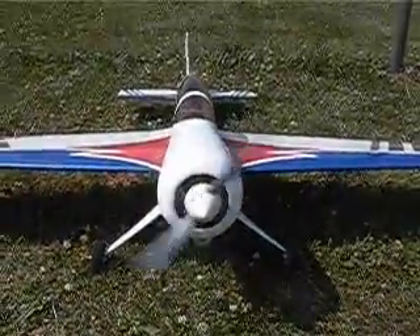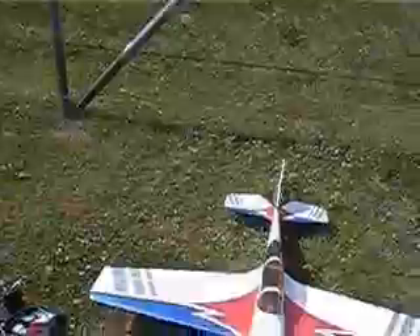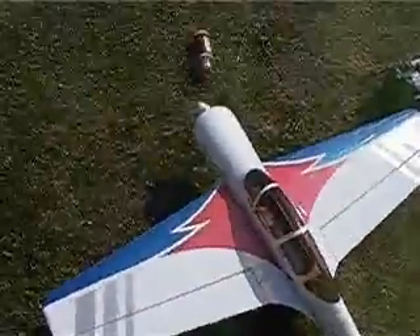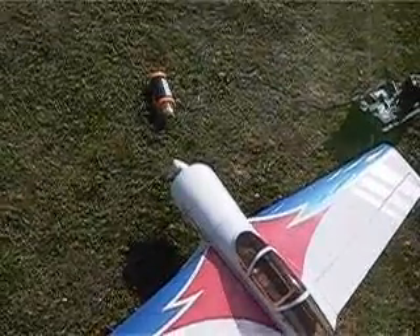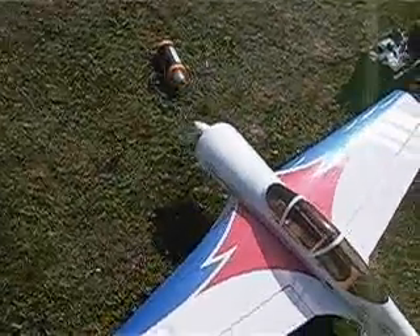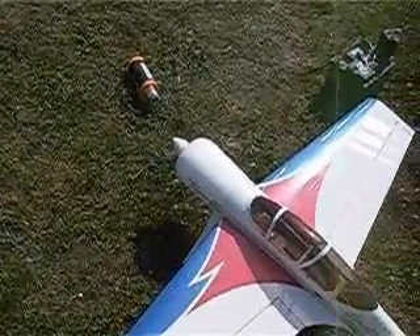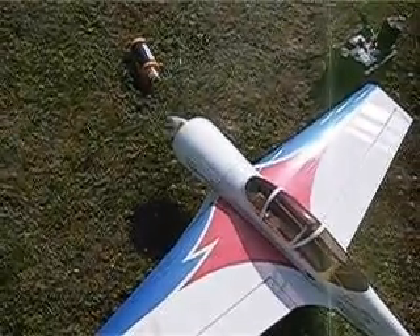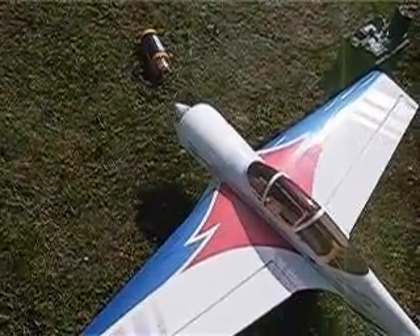It's a bit unstable — this is a problem of the bored-out carburetor. Now I will demonstrate a full throttle. This is a very rich-tuned mixture because the mixture needs to be set so that when the plane is standing straight up in the air the engine must not lean out, because that is when I need full power. You don't need full power for flying normally. So I tuned the engine very rich. Now this is full throttle.